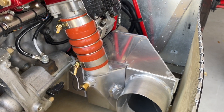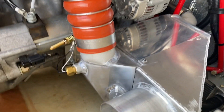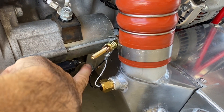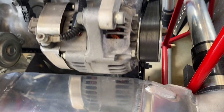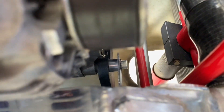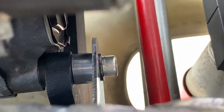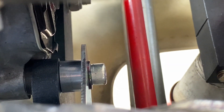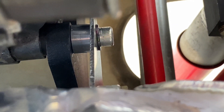The direct-injected engine is kind of immune to detonation anyway, but we want to drop the air temperature as much as possible across the intercooler. The intercooler, if not already fitted to the engine when you receive it, uses two bolts down here that bolt it to the engine itself, and then there's one bolt in the back that supports the intercooler to the engine. It's also used as an engine mount, so you have to be careful — there's a spacer, then the engine mount itself, then another spacer, then the intercooler bracket mount, a washer, and a bolt.